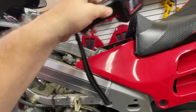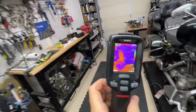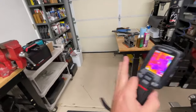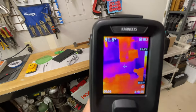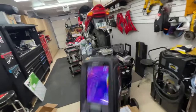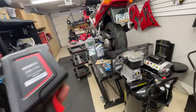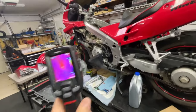With the old gun, on that harness we had to cut a lot of the harness back to expose the area. With this new one, it's going to allow you to pinpoint within a pretty small area - you'd know exactly where to open that harness. There's also an SD card on this that you can pull out, pop in a computer, and do whatever you want with the images. In a motorcycle shop, you could send that to your customer via text message saying 'hey, cylinder one's running really hot, I think it's lean.'